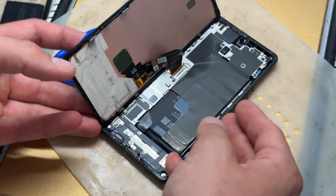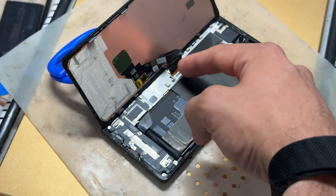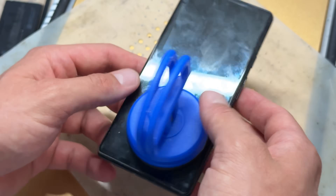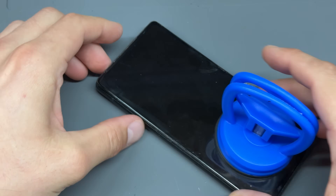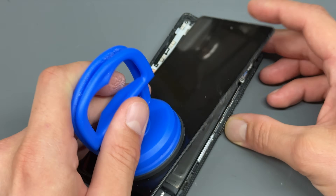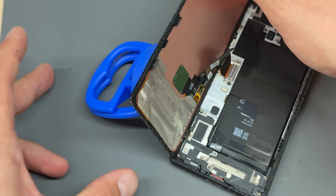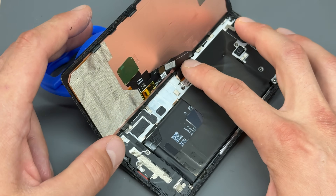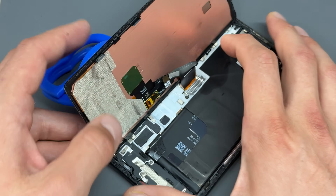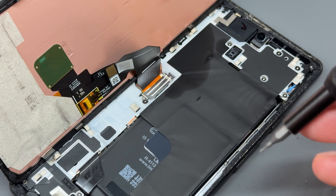The phone is now open — the screen's not quite removed yet. We've just got a screw, a shield, and then we can get the battery out. Let's close it back up and take it over to the cool workbench — cool as in cool to the touch, not groovy. I'm going to leave the suction cup attached to the front screen to act as a stopper, because if the screen falls over there's a risk of damage to the cable, which is a very fragile part.